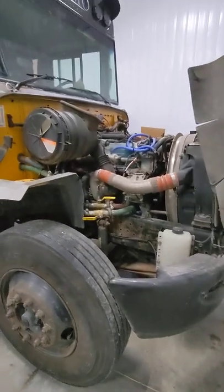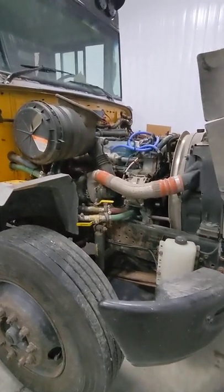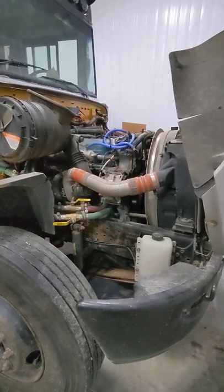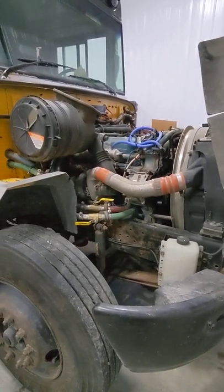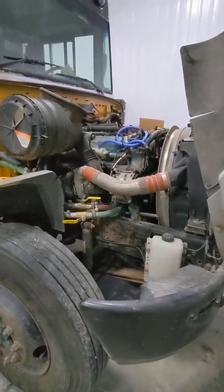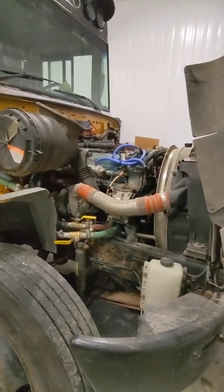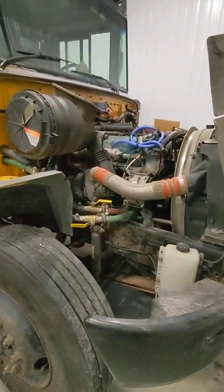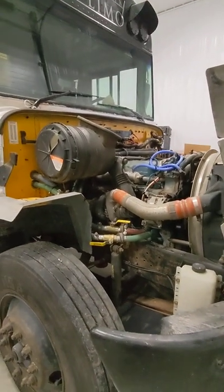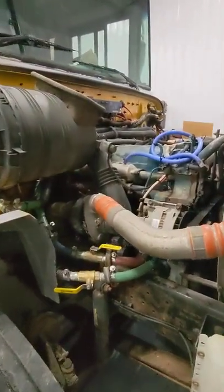When talking about a bus that won't start, especially if you're asking for help online on forums or Facebook, be sure to differentiate if your bus is not starting because it's not even trying to turn over, or if you hear it cranking but it doesn't actually start. Those are two different troubleshooting paths. Everything I'm going to talk about is if it doesn't even try to start — you don't hear it cranking, the starter's not running.